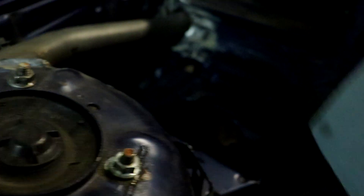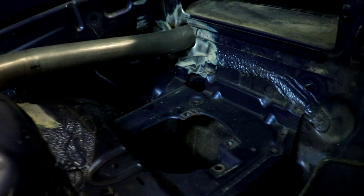I think what's in it now can still go, this can probably drill out as well because we don't need that. We'll see where the spot welds are and probably just take the seam sealer off here as well. Then we can drill that out, take the bracket out and then start sanding.